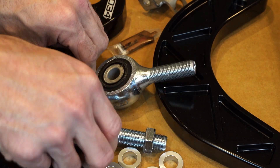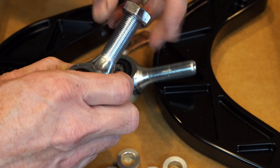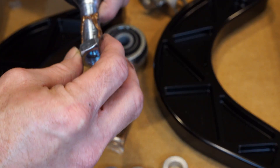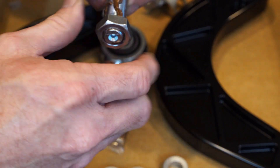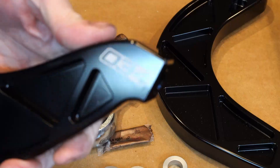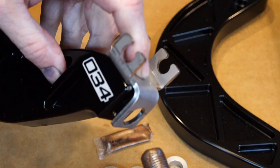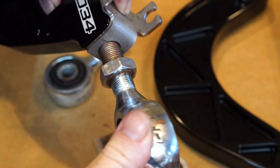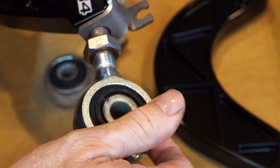Here's the actual kit — what comes with the control arms. You have these bushings with jam nuts. It does come with some anti-seize, so go ahead and put that on there, run that jam nut down, and get it all nicely spread around — that will keep the bushing from seizing up inside the control arm. There is also this brake cable bracket. This is one of the things I changed up; I ended up ditching these because they didn't really work out well for my car, but just know that's what that's for.